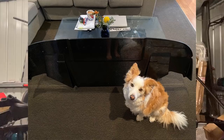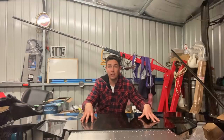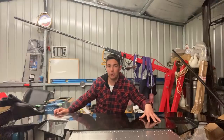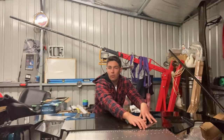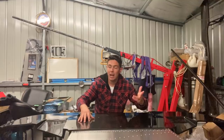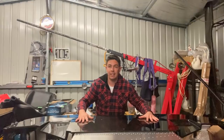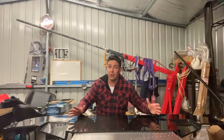As you can see, we've got the massive carbon front splitter — using the universal unit of measurement, it's about 3.5 border collies wide. One thing I'm very conscious of with this piece is making sure I don't destroy it too quickly. I'll be putting paint protection film over it and gluing on some nylon strips onto the leading edge. I also want to make sure the underbody paint doesn't sit underneath it where natural vibration while driving could wear through the resin or paint on the frame.